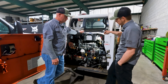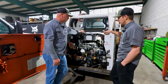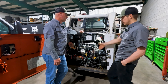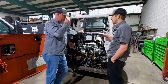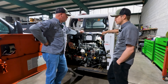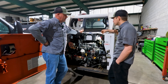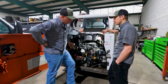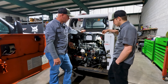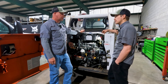The first thing I always like to check because it's easy is injector back leak. If you're not having good rail pressure, one of your injectors could be worn out — you're losing flow because this is a low-volume, high-pressure pump. Even one bad injector can cause significant flow loss. But actually, the first thing I want to try is just a fuel filter. Since it's not pulling the primer bulb flat, it could be as simple as a clogged filter. We'll service the engine first and then run another test to see if that helped.